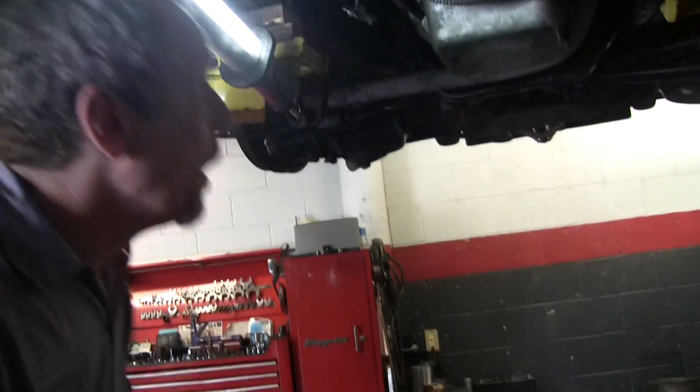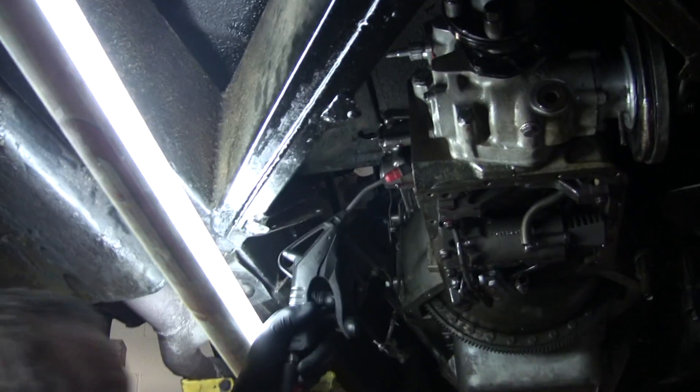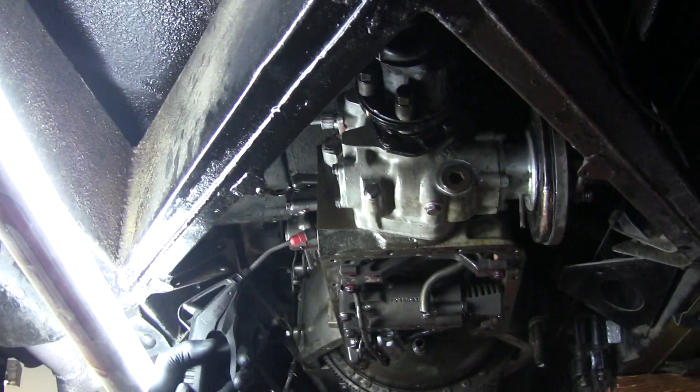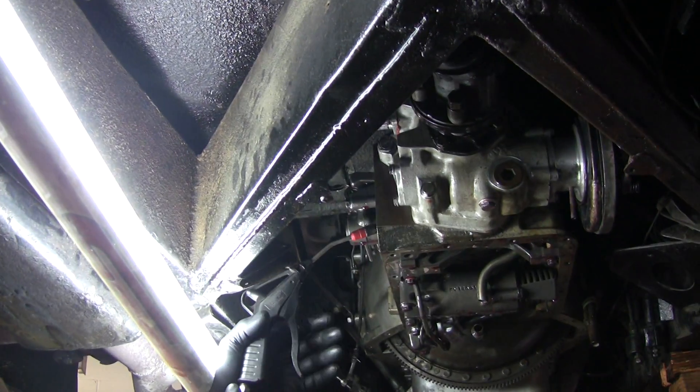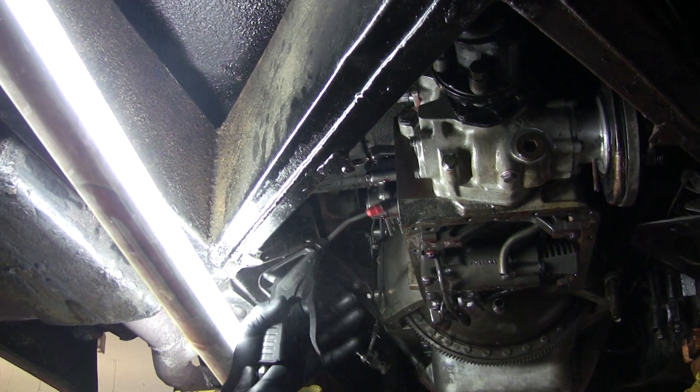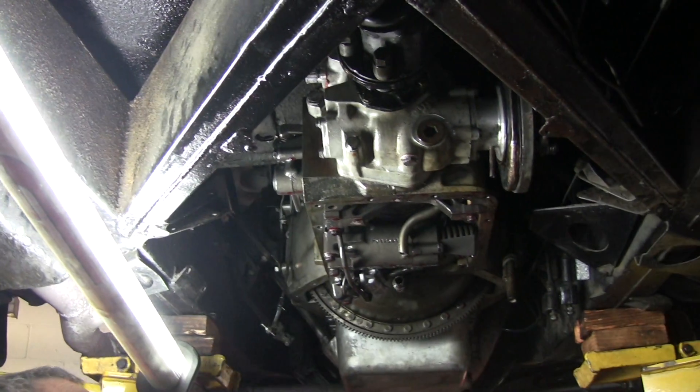This tube can come out. I mentioned the reverse cone — here's where you check; there's an air passage. Hear that? So when I pressurize it, you hear it apply, and when I take the pressure off, it's coming off. And that's for reverse.